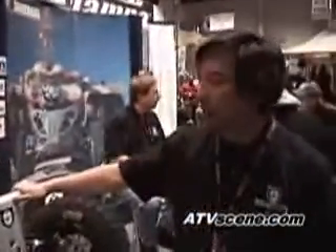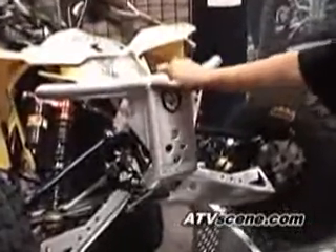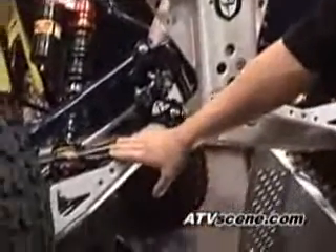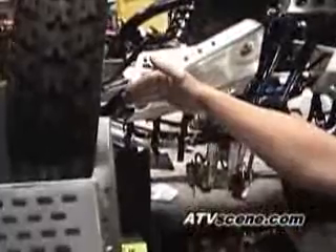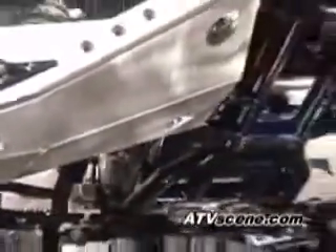Moving over to the front of the vehicle, you'll see that we have a racing bullhorn bumper on here. It's a big aluminum tube, very strong. We have our A-arm guards on here. These pieces are made of aluminum — they don't use U-bolts, they use CNC aluminum hooks. The mounting point on all of these is recessed, so that if you go over rocks or logs, you're not going to damage the bolt because they're up and out of the way. It's part of what makes them more expensive, but it's a much better product because of that.